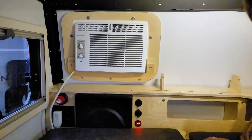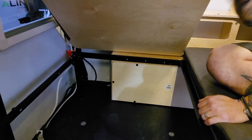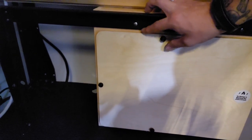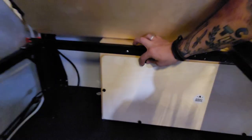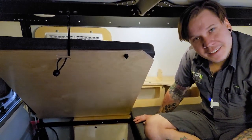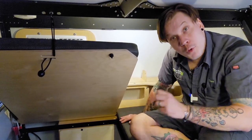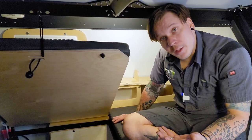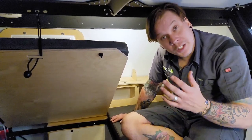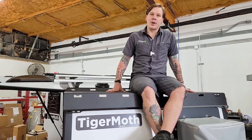Lifting up the front compartment panel, the battery is stored in a box accessible by removing the thumb screws around the exterior — the front panel pops off to give you access. Right now we have a standard lead-acid group 24 deep cycle battery installed. There is maintenance involved: every 90 days, remove the vent panels from the top of the battery, inspect the water level, and top off with distilled water as needed to keep it at the marked level. That just about covers the Tiger Moth walkthrough — we really hope you enjoyed it. If you have any questions or concerns, comment below or give us a call.